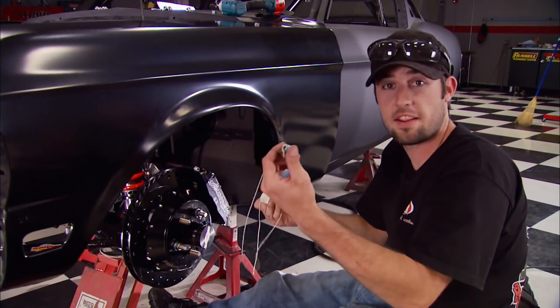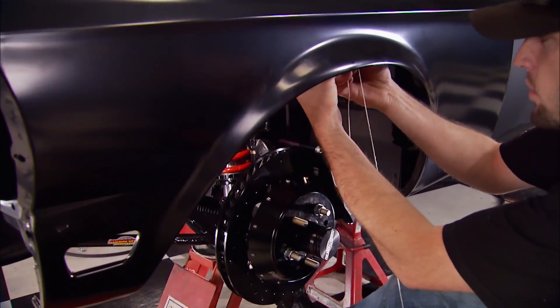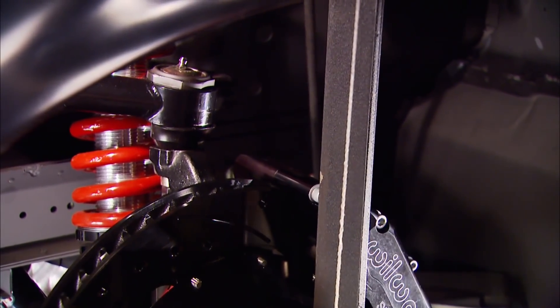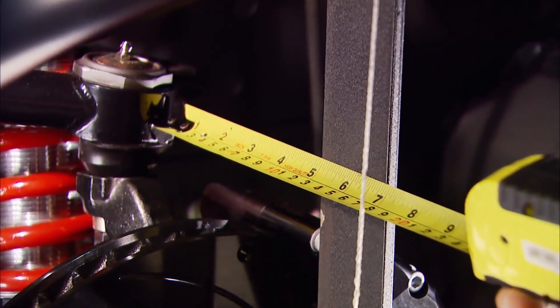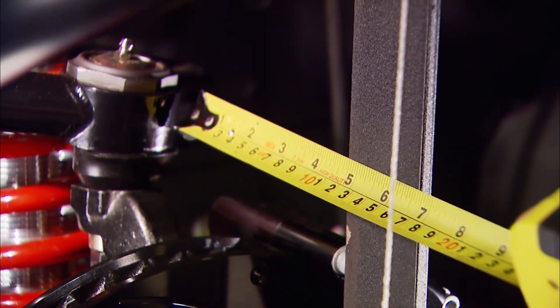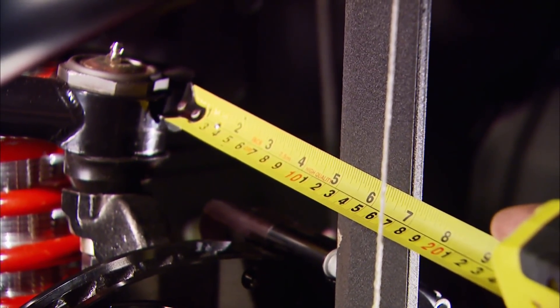The first thing I'm going to do is hang this nut and string on the inside of the fender. This is going to let us know how far we can come out with the wheel, since it still has to tuck underneath it. The straight edge is our reference where the wheel sits on the hub. Take your tape measure and go to the innermost point where the wheel can make interference, which in our case is the upper control arm. We're sitting at 5 inches, so take a quarter away from that, and our offset will be 4 and 3 quarter. And we're still inside of our 8 inch mark inside the fender well.